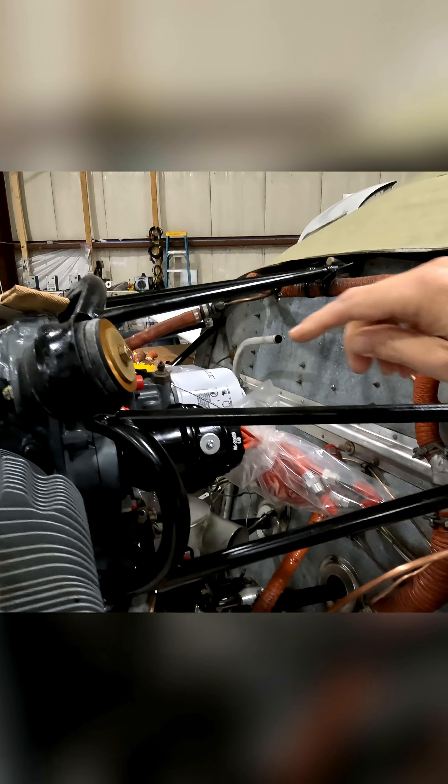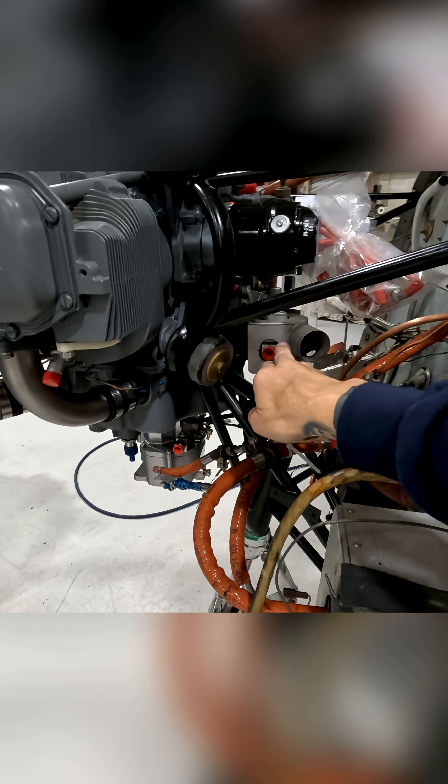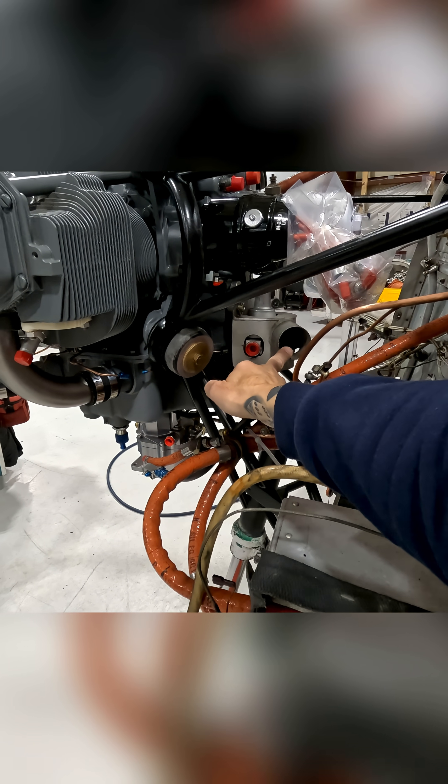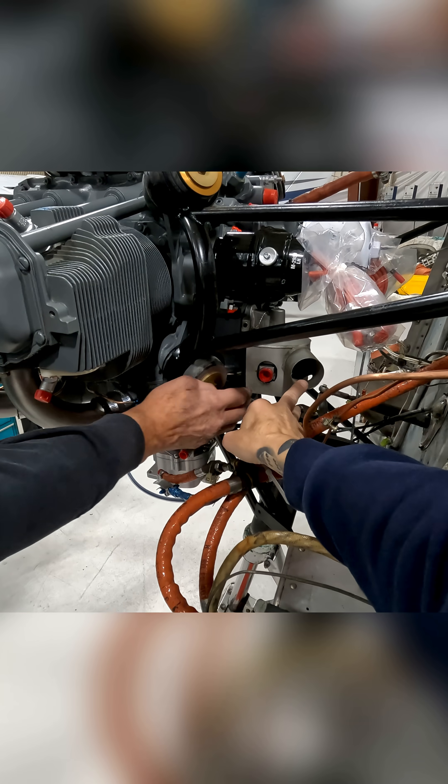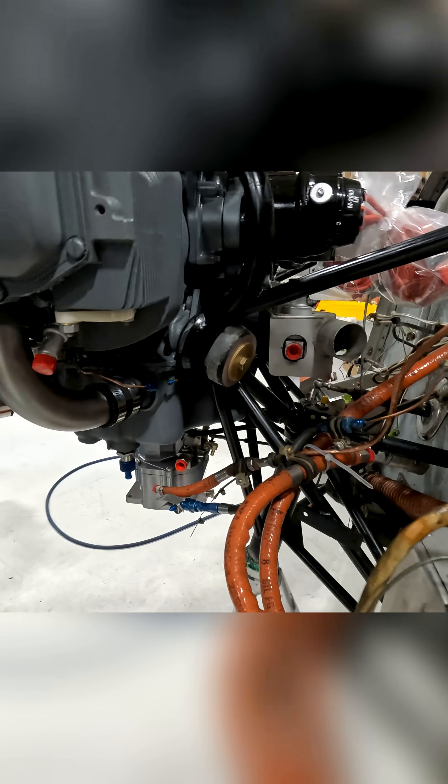When you push that plunger, you've got the two spark plugs, the two magnetos — left and right. And then this is the fuel pump. That's just a cover for cooling air — there'll be a tube that attaches here, comes up, grabs fresh air, comes down, and keeps the fuel cool. And here's a brand new carburetor.